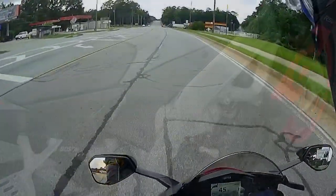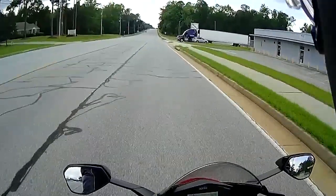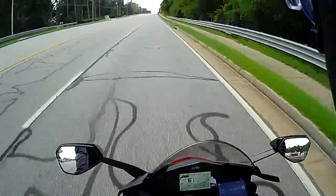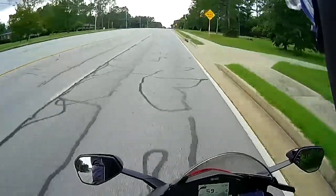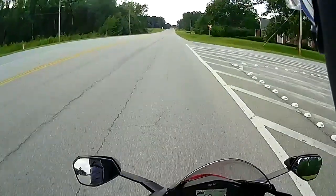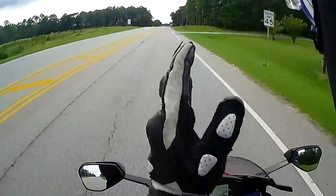I mentioned while I stopped that the bike apparently had a loose oil cap, and that caused some oil to fling out and get all over the exhaust. I did check it. I checked the level about 15 times after that because I was like, oh my god. And then at first I forgot, of course, that it's on the side stand, so I pulled the dipstick out and it was completely dry, and I'm like, oh shit. Then I remembered, oh yeah, the bike needs to be straight up and down level